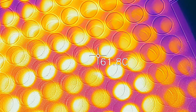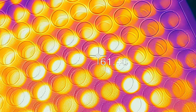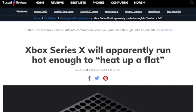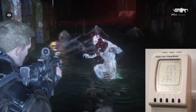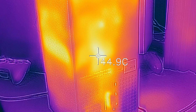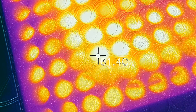The top is the ultimate heat center for the console, and it lights up in spectacular style on the thermal camera. Here I noted a maximum of 62 degrees Celsius — that is hotter than any console test I've ever done before. But remember, Series X is pulling more power than any console I've ever tested. Put your hand above the exhaust outlet on the top and you can definitely feel the heat. You really do need to ensure that hot air can escape, so keeping Series X in an enclosed space is not a good idea. Those reports of using Series X to heat your flat must be tongue-in-cheek, because the peak power consumption is under 210 watts, while any electric heater starts at around 2000 watts — an order of magnitude higher.